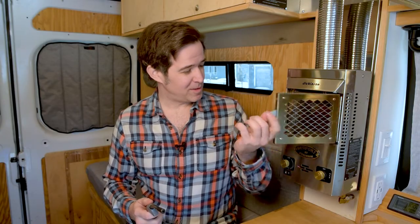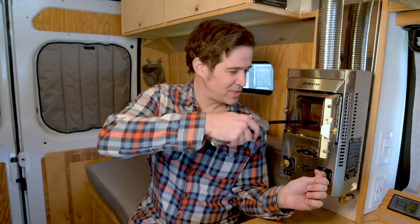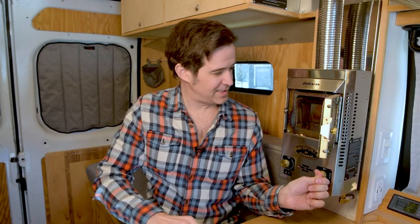Making fire is easy enough. Grab your lighter, open the door, push and then turn to low, push and hold, light and then close the door. Hold the knob in for about 10 to 15 seconds until the thermocouple heats up.